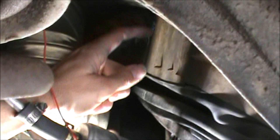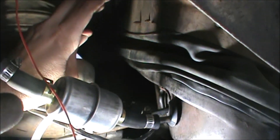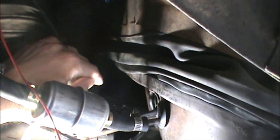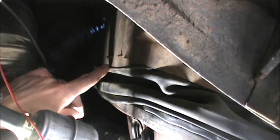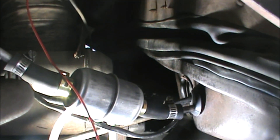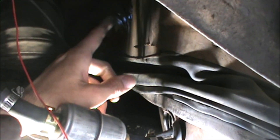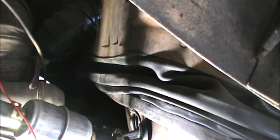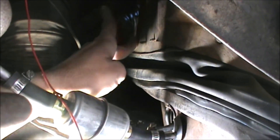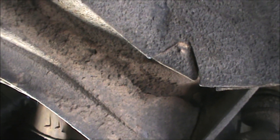Putting it up on the shroud, it would be more secure and protected, but still easy to get to if the wheel is off. I didn't really even have to take the wheel off — all I had to do was jack the car up. But then I have to run a bit more rubber fuel line, and the starter solenoid is right here, so we still have a potential spark source, though not as dangerous as putting it in the engine bay. I do worry about these screws and a fuel line rubbing on them, so I'd have to put some kind of safety cover. I'll probably put some Rust-Oleum rust reformer on here to keep that from rusting any further, and I may take the remains of that heater hose out — it's half rotted to death, and I don't drive the car in winter.